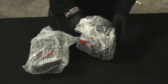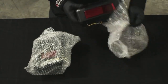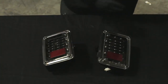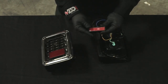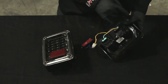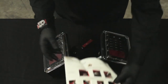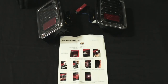Now we have the two tail lights. Unbag them. Then you want to take a look at the back. You'll notice you have a resistor with double sided 3M tape. This is all pre-wired — it is plug and play. This is your main harness and that's the light. Both of them are the same, one for driver, one for passenger. Also in the box you have installation instructions. This video will go through all the steps on that page.